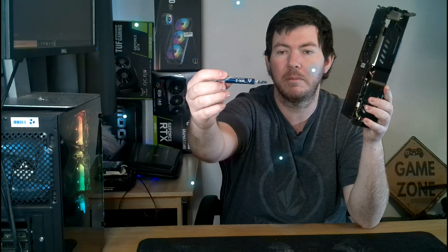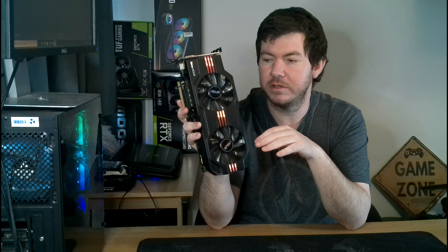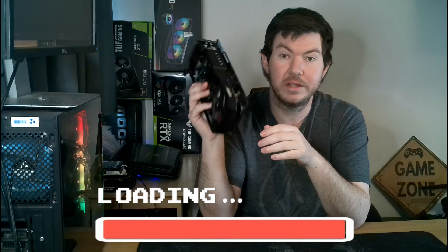I'll be using some extremely good thermal paste, as I've mentioned in previous videos. So this is a GTX 570 — I'll benchmark it to the full, run a couple of stress tests, document the temperatures before and after, and run the same games before and after on the same settings. I'm going to run the games on ultra and try to squeeze out DX12, as I believe this card is DX12 compatible. It might fail, but it might work. What I'm hoping to see is a before-and-after improvement on frames per second, or at least a few degrees drop in temperatures. So let's get to it.